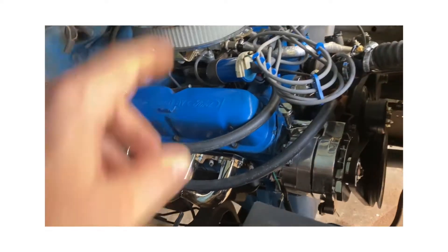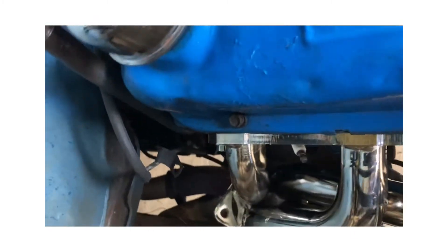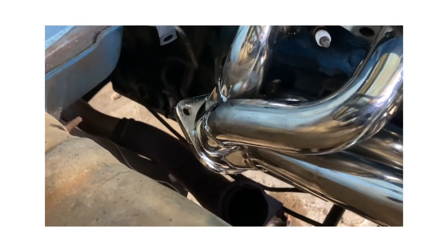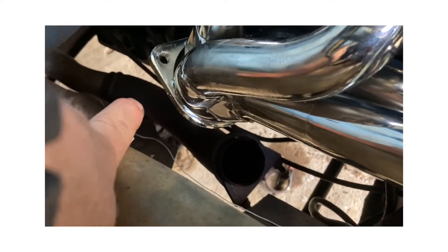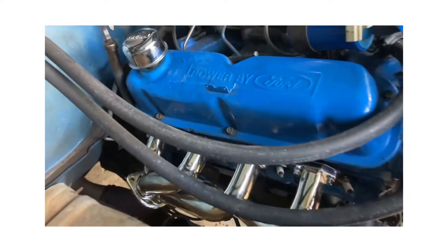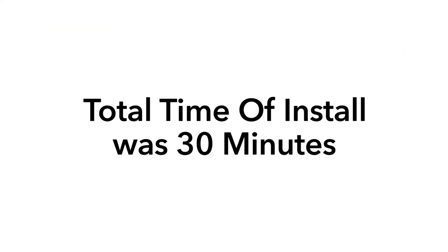Look at that — perfect clearance. See right down in there, it goes straight down. That's my unbolted exhaust remedy we had on the manifolds — one of those flex exhaust pipes — but you can see the angle goes straight right back down there. There's the starter — no problem, not hitting anything. And you have access to all the plugs, so that's a main plus for me. Line up the gasket a little while you brace it — that definitely helps. Try it again now that it's a little more level to each header port.